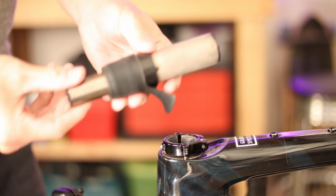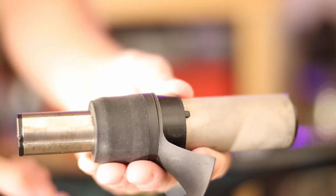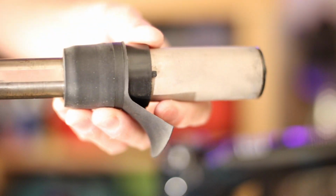And if you have your front wheel resting on the ground, and you don't mess with the locking collar too much, there's a pretty good chance you won't need to mess around with the preload later when you go to reassemble everything. Now if your fork does end up sliding down a bit, or the system gets bumped around, you'll probably want to make sure your headset preload is properly set before you put it all back together. And if you need a refresher on how to do this, again, there's a pretty detailed outline in the previous video that I posted, which is linked down in the description.